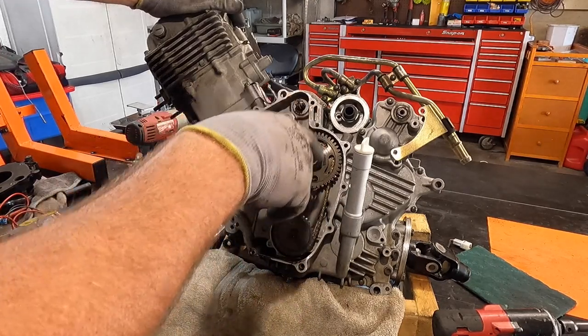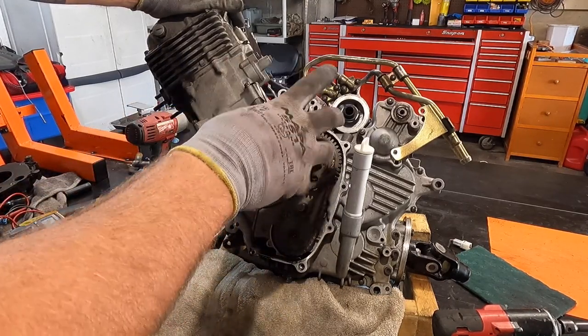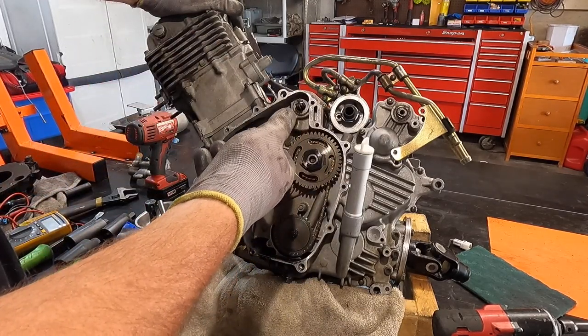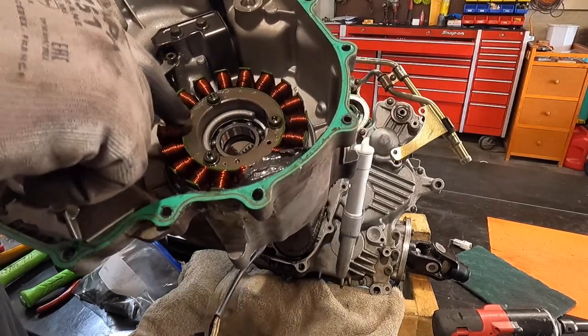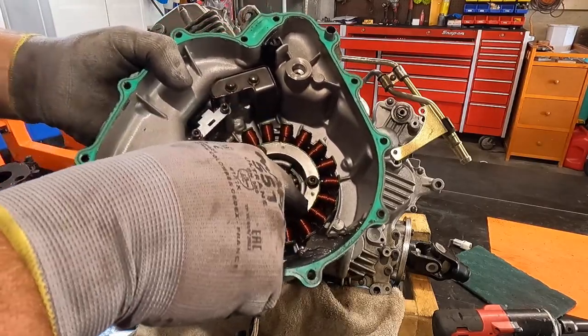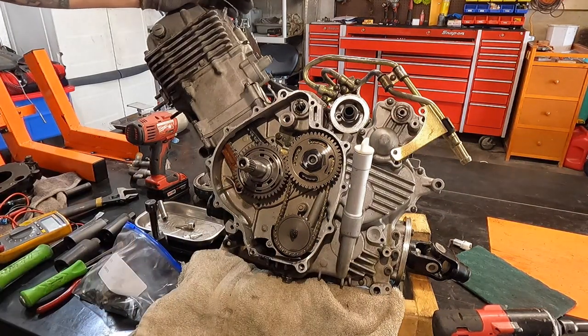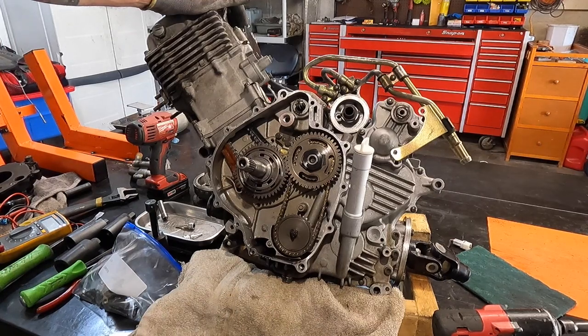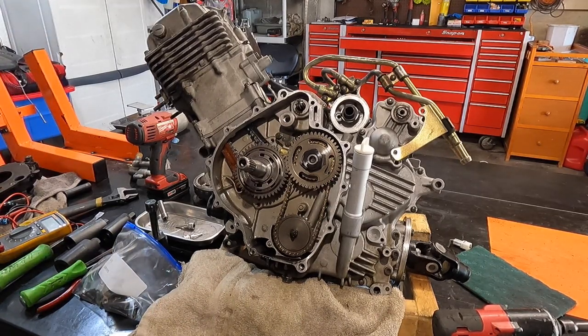Do the process in reverse to put it back together with a new gasket. Tighten all the outer cover bolts to about 10 to 12 Newton meters all the way around. For the fan cover Phillips heads, I'd use blue Loctite — I've seen those back out on motorcycles and cause issues when people haven't used Loctite or torqued them properly. If you have any questions about motorcycles, ATVs, or UTVs, leave a comment below or email me at limitlesspowersports78@gmail.com. If you haven't liked and subscribed, please do — it helps the channel. Thanks for tuning in, I'll catch you on the next upload.